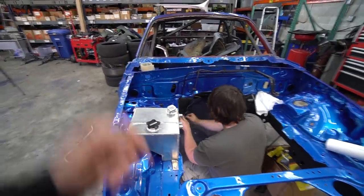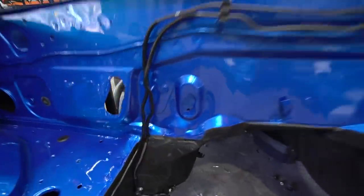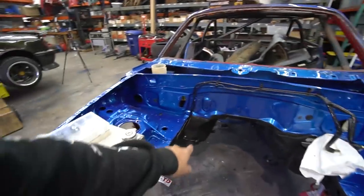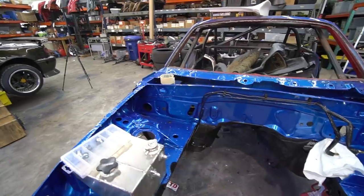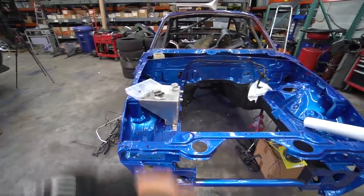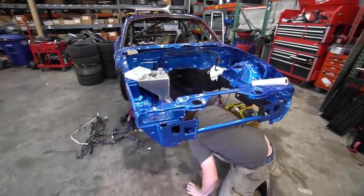That's part of building cars — you put the engine in and then you're like, let me toss the brake lines in, and then, oh crap. I pretty much finished up the brake line routing. Definitely would have been better to do new lines, but that line runs all the way to the rear, so we'd have to get a spool of line and order the right fittings. This looks decent — it looks a lot better than my car. P-clamped. Ben's putting one more clamp on and then we can move on to engine in subframe, engine in car.